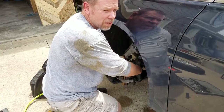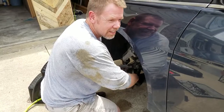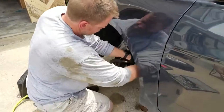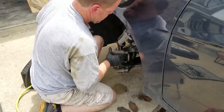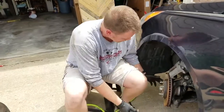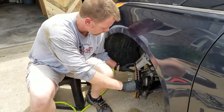We're usually pretty good at knowing left from right — today, I don't know. All right, so we got that out. We got the caliper frame out. I'm going to take these rotors in to O'Reilly to get them mic'd — see if I've got enough to turn them. They don't look too bad, actually. I'd rather not pay for new rotors.